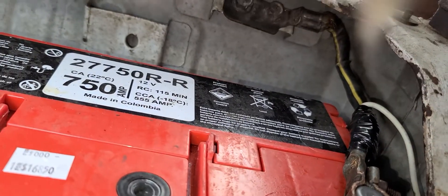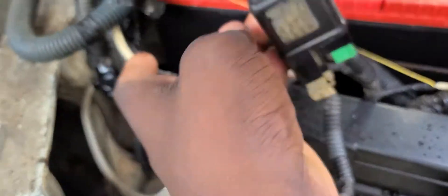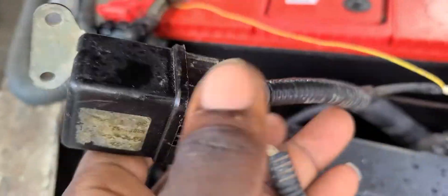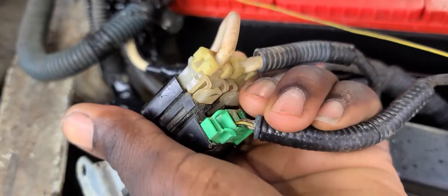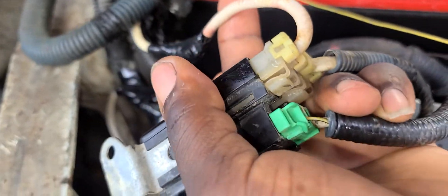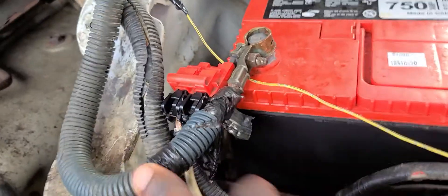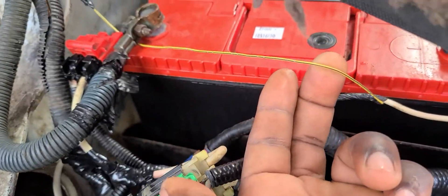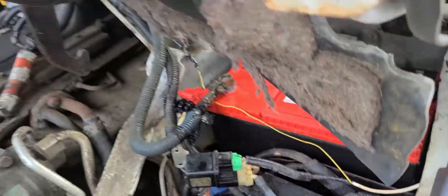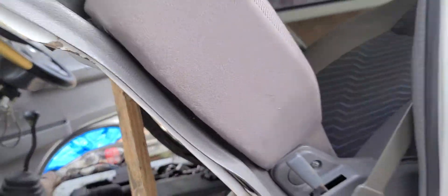I ground the small wire right here — that's the signal wire, it goes to ground. The terminal right there receives that. This other one goes to the live terminal, fed from the battery. And this one sends the signal from the key switch. I'm going to show you now what it looks like and how I bring it up to start.